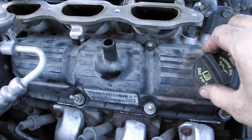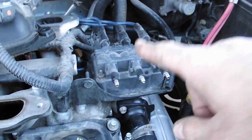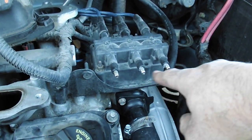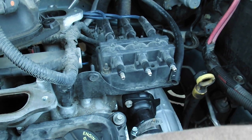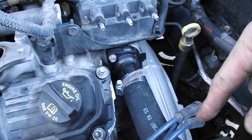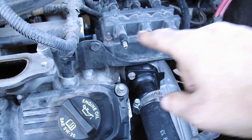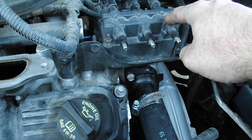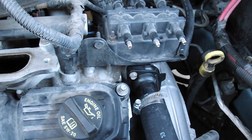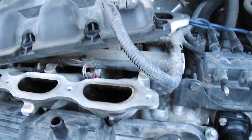Well, it takes a little bit of squeezing in again, and again, I had to disconnect the spark plug wires in order to get the piece to come out easily. Again, I numbered them so they'll go back into place in the right firing order. That's very important, so make sure you mark them. This is 2, 4, and 6, and I'll put that back together, and we'll start tightening these screws and putting the manifold back together.